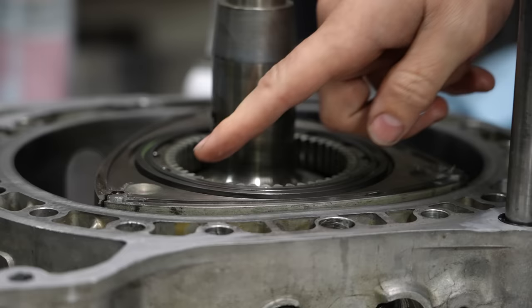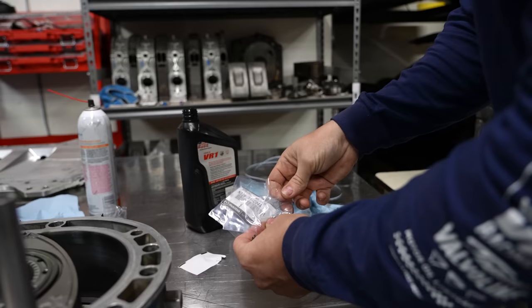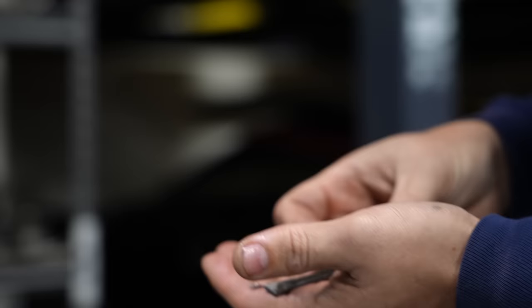Some of my buddies in a group called Hotel 7 pointed out, if you notice right here, my rotors are a little bit too big, given that it's a four rotor and everything. If I had time, I would grind this down, but the motor's doing it for me. We had one apex seal spring that was a little bit flatter than the rest, and the same with one of the smaller ones. This motor is too important to not try.